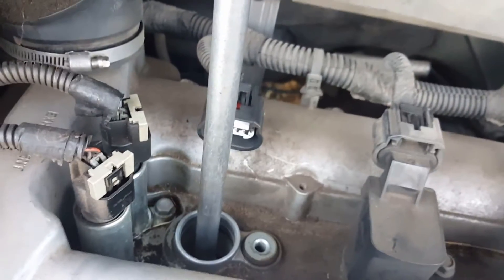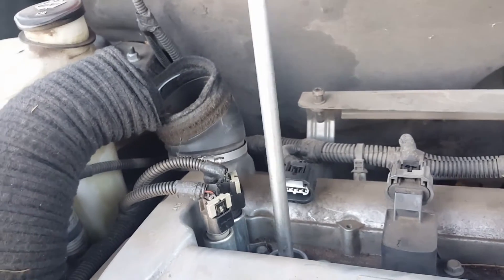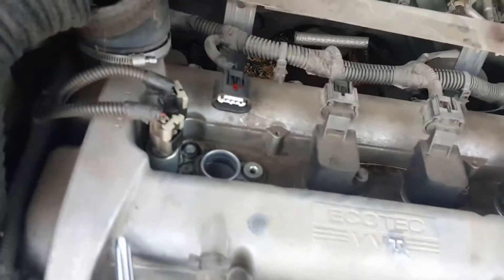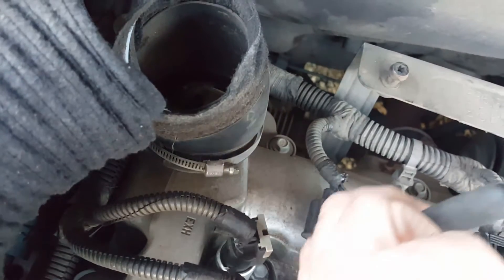My extension is overkilled because all of my extensions are at work. You want to loosen up the spark plug. So now you've got the spark plug loose — reach down in there with a pair of needle nose and pull the spark plug out.